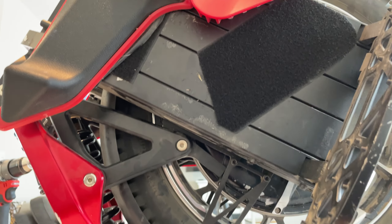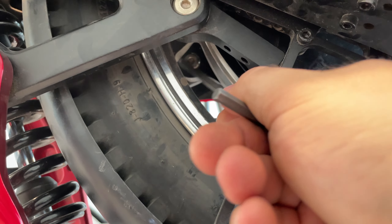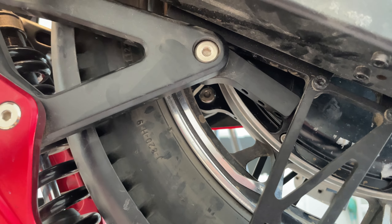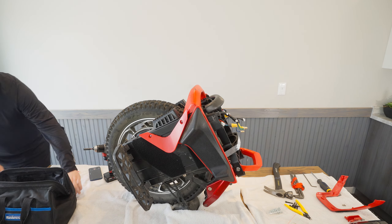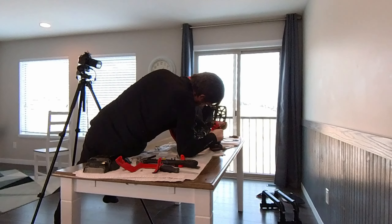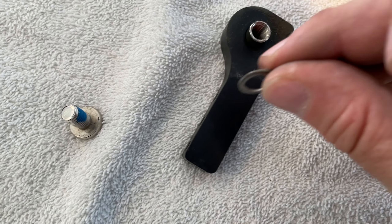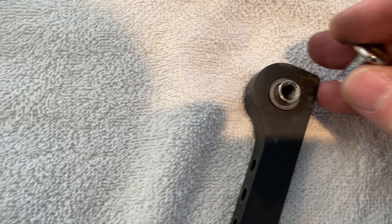You can't do the last part of the suspension with the stand — you've got to kickstand it and crunch the suspension so you can get in behind there. Put an Allen key in there and do that on the other side to loosen both off, and then we can get to the motor. When you're taking off these last suspension arms, don't forget about the washer. The washer goes on there like that, and then this goes on like so — that's the assembly.